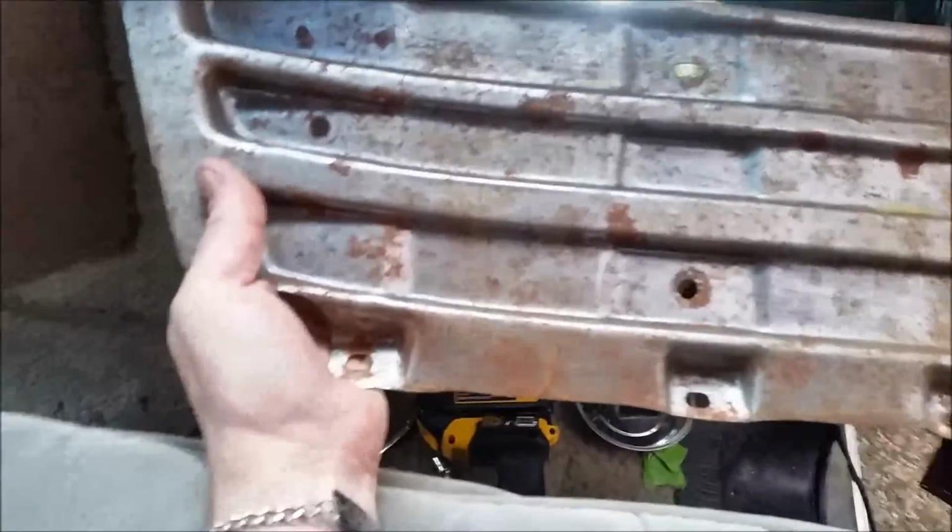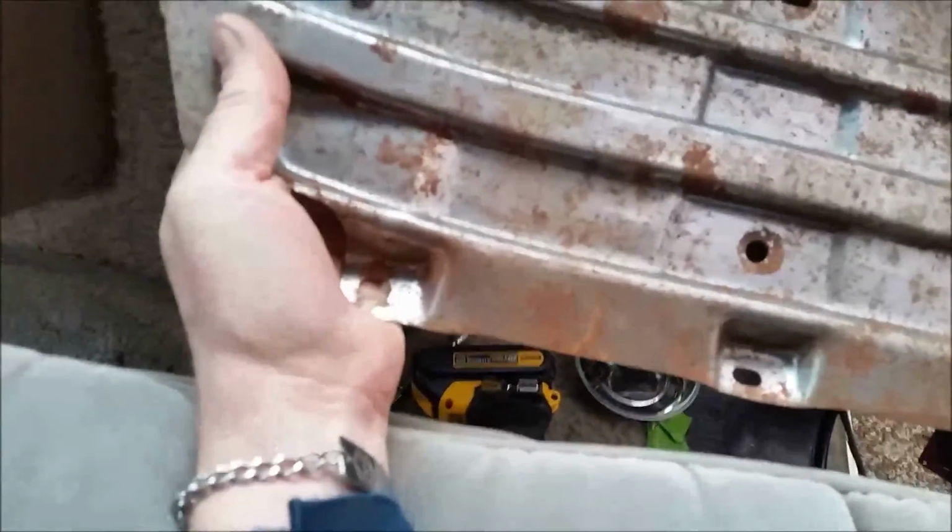So no real brain surgery, but there is the bracket fully installed. Bolts there, there, and there. They're the kind of sheet metal-ish, machine threaded-ish, 8mm headed black oxide screws. Now we put the front plate on, which is located here. And I have to figure out what side and orientation, but I'll do that right away.